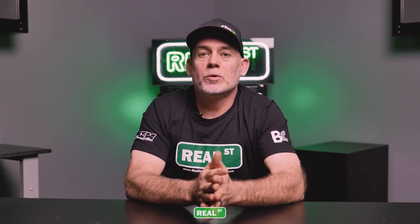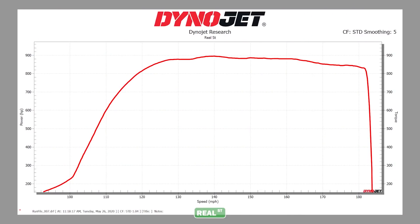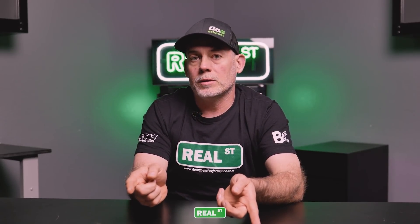Here's an example of a loose torque converter. When I floored the car and it went up in boost, the engine horsepower is basically the same all the way across the graph because the engine just goes to one engine speed and the tires are playing catch-up. Eventually the torque converter gets a hold of the slip and the tire speed increases, but it's a funny-looking graph. If you're dynoing an automatic car with a loose converter, you may end up with something that looks like this.